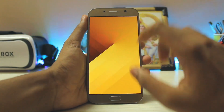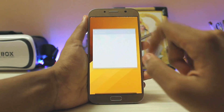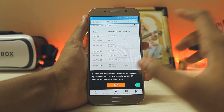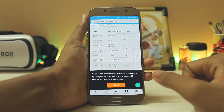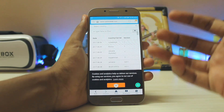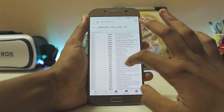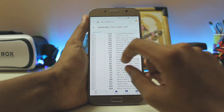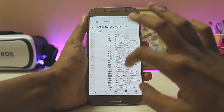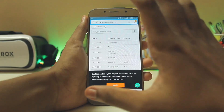It's running Android 6.0.1 Marshmallow right now. The link to download the actual firmware is given in the description. It's important to install from a firmware matching your country — I live in India, so if I install the Russian firmware I would basically lose VoLTE until I install the Indian one. The Indian firmware is not available right now, but I've provided links to check for it. I've downloaded the SER version — SER stands for Russia.